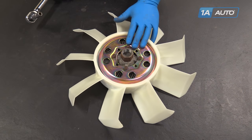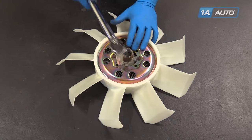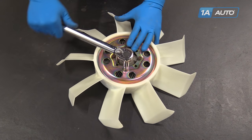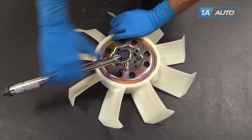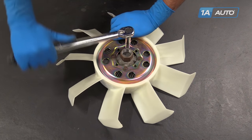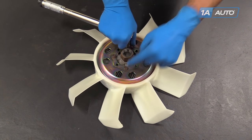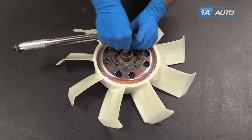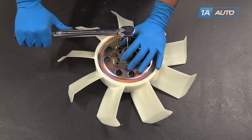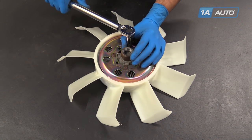The manual shows that these bolts can be torqued from 14 to 19 foot-pounds. We're going to go ahead and torque them to 15 just to be safe. We're going to torque these just the same way you would torque a wheel — going across and across to make sure it gets tightened down flat. That way it doesn't pinch on one side, rotate out of balance, and create a vibration.